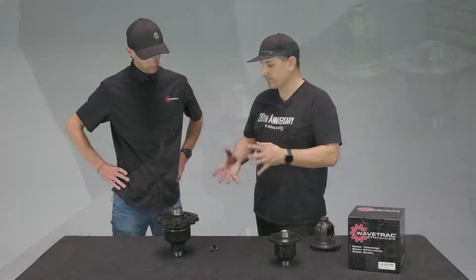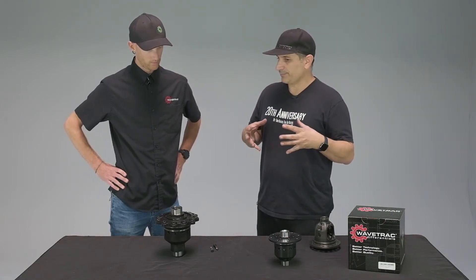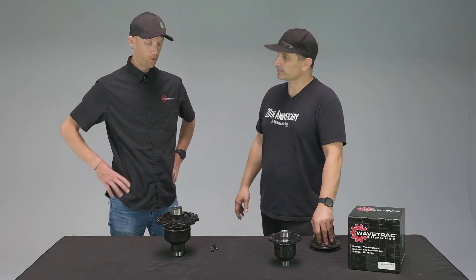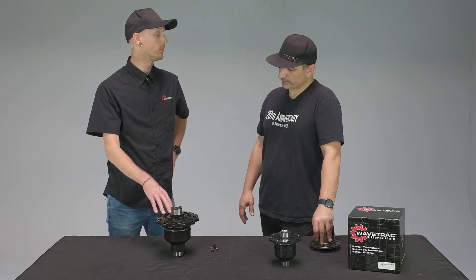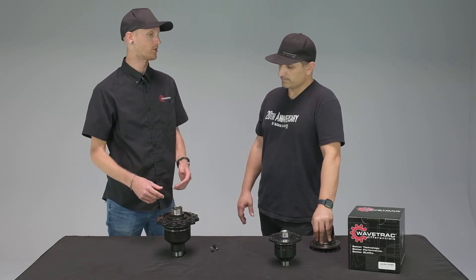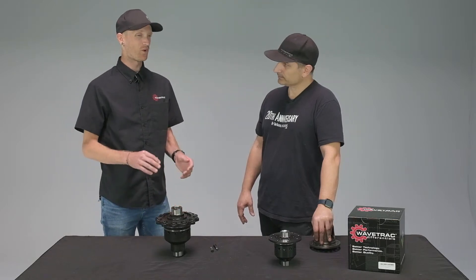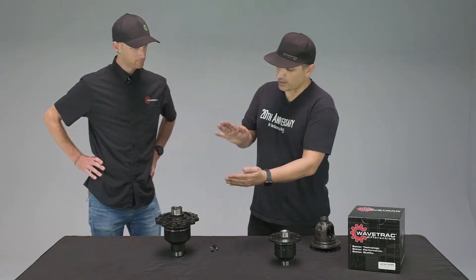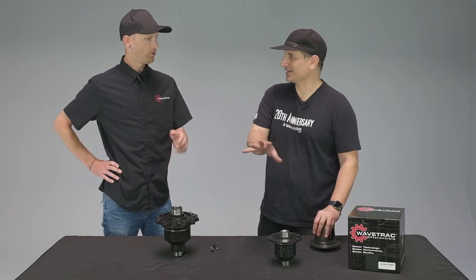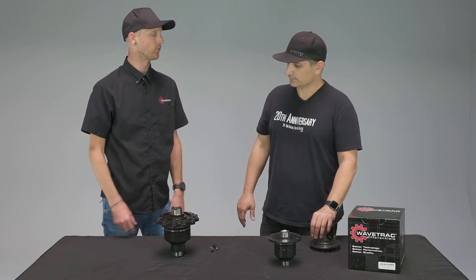If you're installing a WaveTrack in the rear diff and reusing the same ring and pinion, you still need to reset the backlash because WaveTrack holds tighter tolerances than the factory. With BMW cars, it's rare to see two that are exactly alike. Always double and triple check your setup — WaveTrack holds tight tolerances on bearing distances and other dimensions. Don't touch the pinion; just check initial ring gear backlash and bearing preload, pull it out, then reconfirm everything when you put it back together.